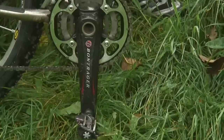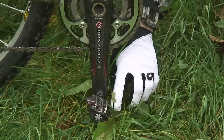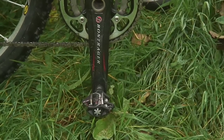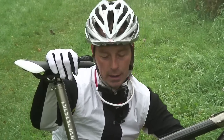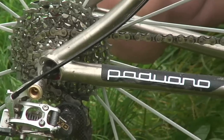This bike's unusual because it has quite a low bottom bracket. For cross-country racing, it's actually not an undesirable thing, particularly on modern race tracks where there aren't a huge amount of rocks generally speaking, and cornering stability is important. By lowering the bottom bracket height between the wheels, what you're doing is lowering the overall centre of gravity. By lowering the centre of gravity, you increase stability and that just creates a bike which sticks extremely well through the corners. So you can see it as an upside or a downside — it just depends which side of the performance cross-country line you decide to come from.